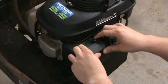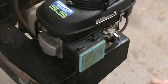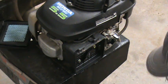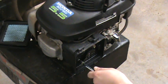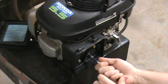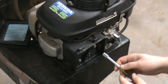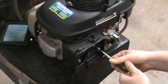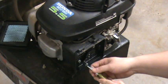They're pretty much all the same and really similar. Push down on these two tabs, pull the air cleaner cover off, pull the air cleaner off. Put those somewhere to the side. Being a Honda, you can just about disassemble the whole thing with a 10 millimeter socket. There are three bolts in here — two of them go all the way through the air filter housing and actually through the carb to hold the carb to the engine. There's another one at the top right that holds the air filter housing to the throttle bracket — that's the short one. Pull it out.